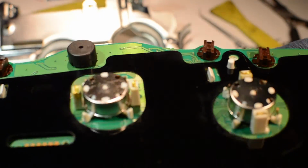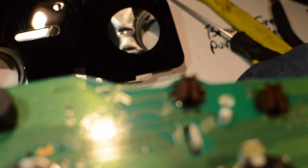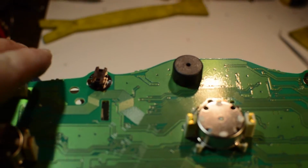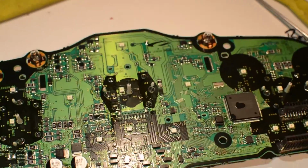And this is a funny gasket when you go put it back on. You'll see just what I mean when it's time to put it back on, because there's only one way that thing goes on there. So, setting that aside, now to get our PC board out of there are just two clips here. That's a two-handed job. You just pull on that little plastic and the board will come right out. Stand by. Okay, and there it goes. And now we have our 350Z main cluster board out and ready to work on.